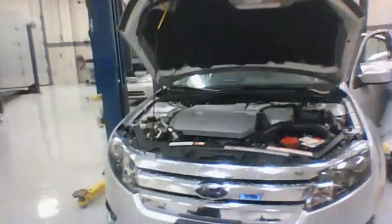This is a hybrid vehicle — you can see the orange high voltage wires in the back. Traditionally, what we're going to do is set up a perimeter, let everybody know in your shop or even at your house that you're working on a high voltage vehicle: don't get close, don't mess with anything. Take the key out, let everything power down, and then go ahead and pop the trunk.